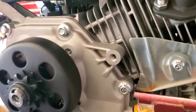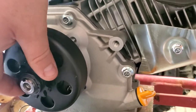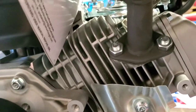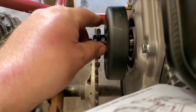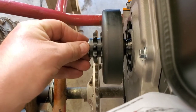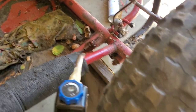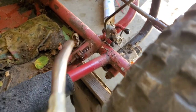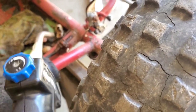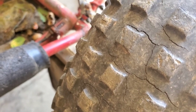Clutch barely fits past it. You gotta lift up the motor to put it in, slide it over anyways, but that should work out pretty good. The alignment isn't bad, just need to shim that a little bit. Now what we gotta do here is get this piece off, because the cable was originally part of this weird adjuster. So what I'm actually gonna do is rip that piece of cable out and see if I can stuff that other cable in. Maybe it'll work, doubt it. But see if I can reuse that adjuster.